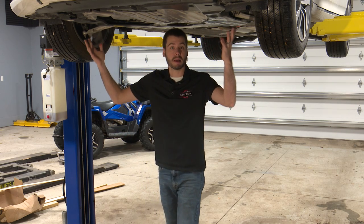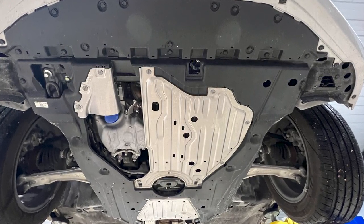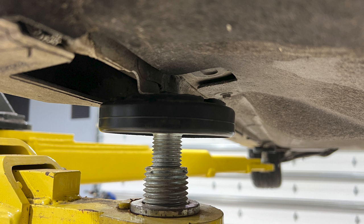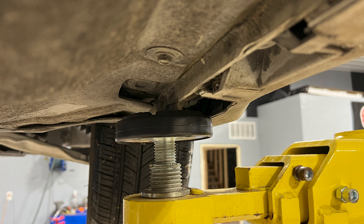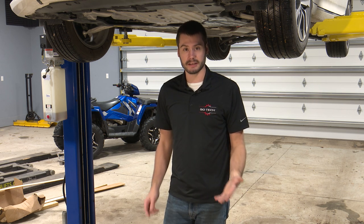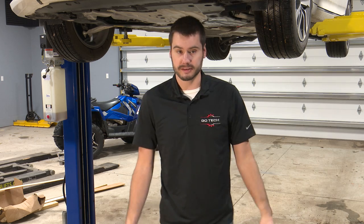Lifting up a hybrid vehicle, you do want to be cautious because like many new vehicles today, there's not really a place to put a jack under the front of the car. We have shields everywhere under the front side of this thing. So what you're going to want to do on these and many new cars is lift on the manufacturer lift points on the sides of the cars — they have a little steel piece with an arrow showing where you should lift. If you're doing this at home, you could still use ramps, or if you're using a jack and jack stands, lift each side independently. Definitely check the owner's manual for where to lift the vehicle. So let's get the oil draining and then go over the rest of the underside of this car.